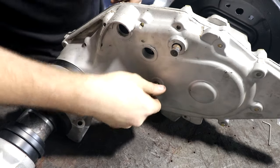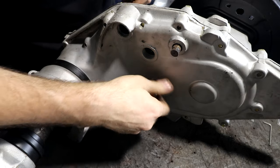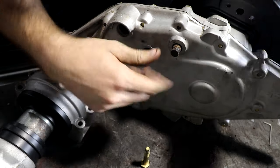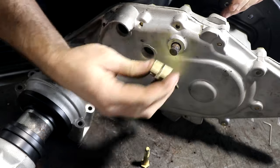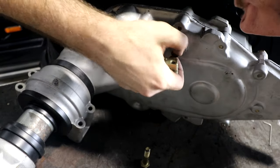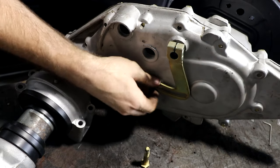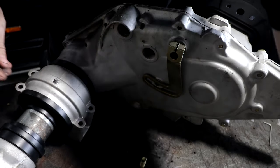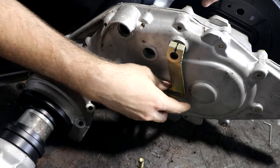Now this is all tightened down, this is the bolt that goes to that aluminium washer. I put it in here just to stop that washer from falling down. What we can do now is put the chain tensioner on. So this is that white gear, or the white wheel, that I made inside. This piece is what actually sets the tension. So there's a service interval for this, like changing your oil, where you readjust your chain tension. This actually has a solid spline on it, so it only lets it fit on in one position. I just have to work out which position that is. So this piece actually moves that tensioner inside, and we can adjust the slack on the chain. And then this bolt combined with this piece clamp it all into place. So we'll roughly set the tension now, but that stuff will all reset it once it's all put on the car.